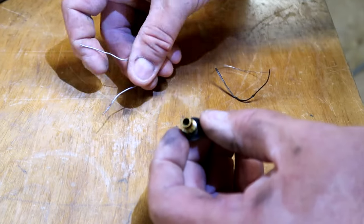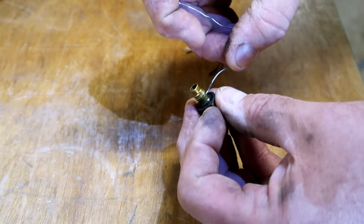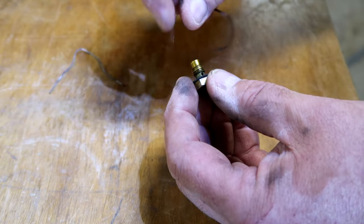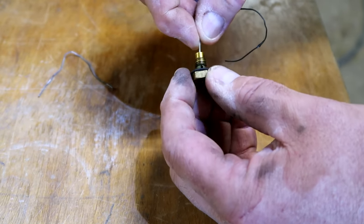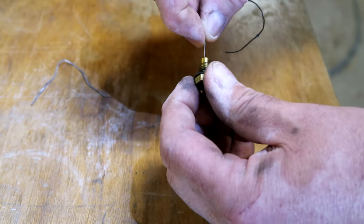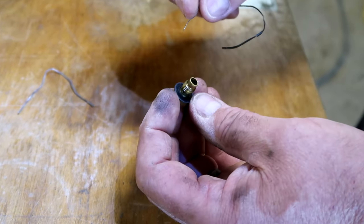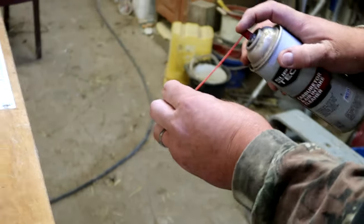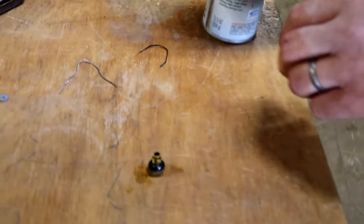You'll notice right here, there's a hole and it runs all the way through, and that's where it picks up the fuel and pushes it up through the center. Generally, this gets clogged, and that's what you want to clean out. I've got a piece of wire here, and this is a bread tie — the bread tie fits through. You can actually buy kits of all different sizes of wire, but why when you've got bread ties? I'm just going to clean that out. I'm not seeing any obvious debris pop out, but it feels a little tight in there. I'm going to use some carburetor cleaner and just spray down the middle. I'm convinced that is clean.